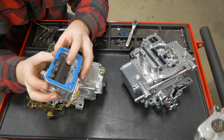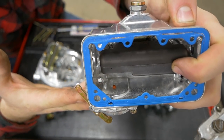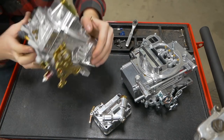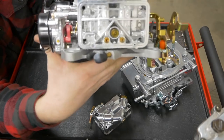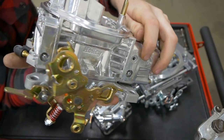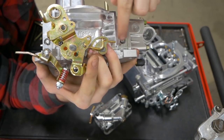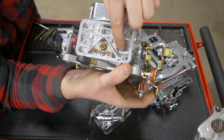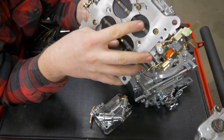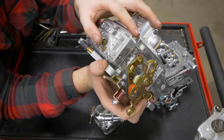Front bowl — same as the rear. In this one you have your accelerator pump down here on the bottom with a rubber nipple sticking through there for the one-way valve. Up front we have the front metering block. This is actually a dual metering block carburetor, which means there's a metering block in the front and a metering block in the back — which in this case is also known as a four-corner idle carb because it's got four idle mixture screws. What these screws do is run a tapered screw down inside the bore and meter the amount of fuel fed to the idling circuit, changing your idle mixture ratio.